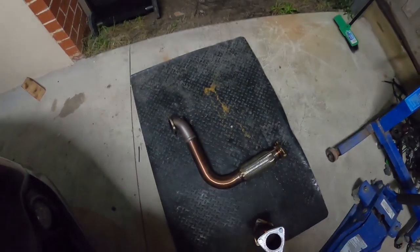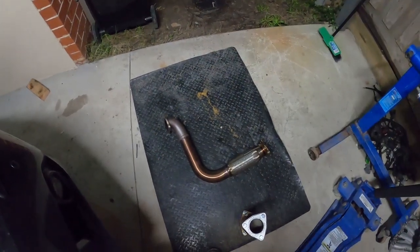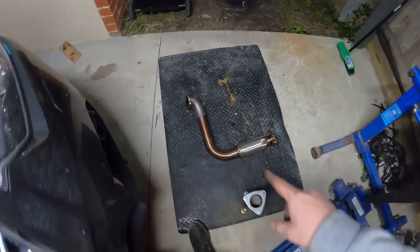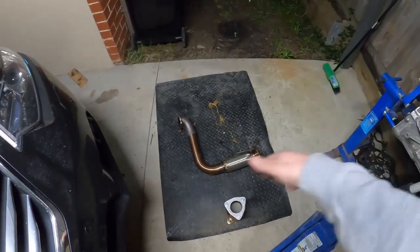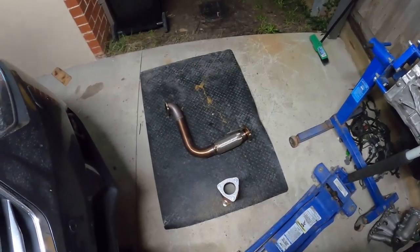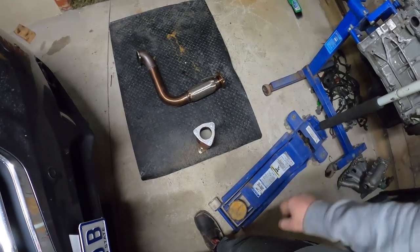I don't know if anyone can recommend anything to me, because I really want to get the increased flow, because this downpipe, perfect. Perfect flow, gets rid of that clunky cat. Nice smooth piping. Nice smooth opening there, great collector. Although it didn't fit, I don't know why just having a straight piece of pipe caused the rear mufflers to vibrate and buzz. Even putting a cat in, still buzzed.